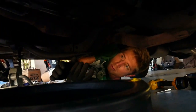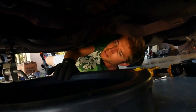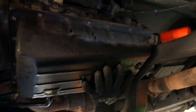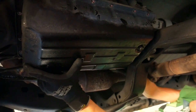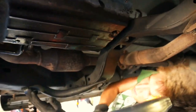I'll get my bigger drain pan and break this loose, then dump anything that's left into it. I'm going to take a little hammer - don't use a metal one. When I use the hammer I'm hitting on the ridges and stronger areas. I'm going to avoid the flat spots in the middle of the pan because you'll bend it even with a softer hammer.